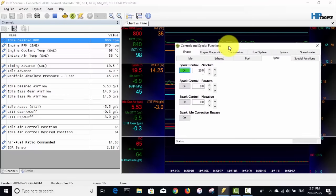With timing locked at 20 degrees, we're at a flat line of 19.5 degrees, about 800 RPM, and 46 kPa of manifold pressure. I'll bump timing up to 22 degrees — RPM has increased, we're hitting the high 800s to 900 RPM occasionally, and manifold pressure is at about 44-45 kPa. I'll go up to 24 degrees — manifold pressure has come down a bit to 43-44 kPa, and RPM hasn't changed much, so I'll go up a little more.